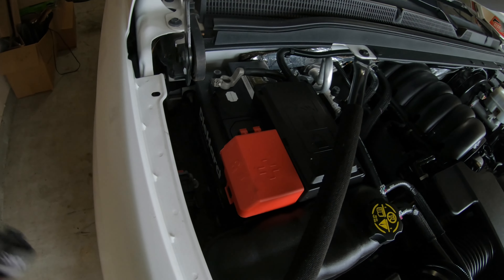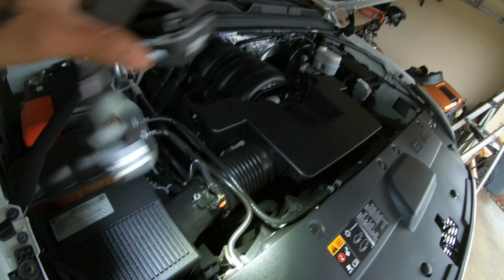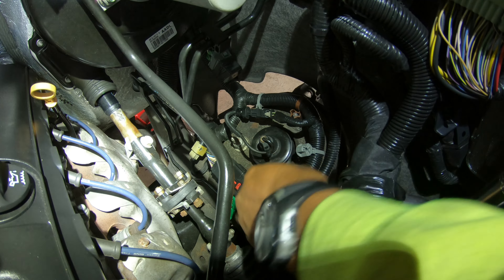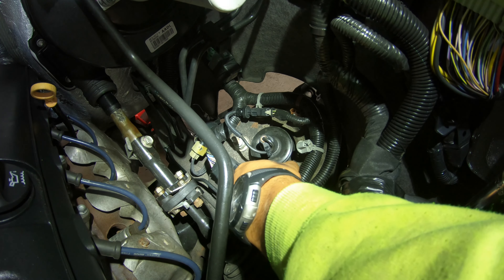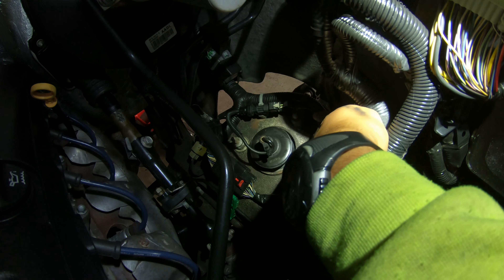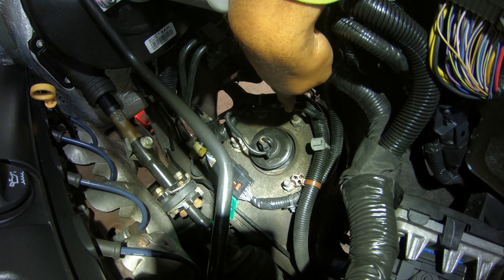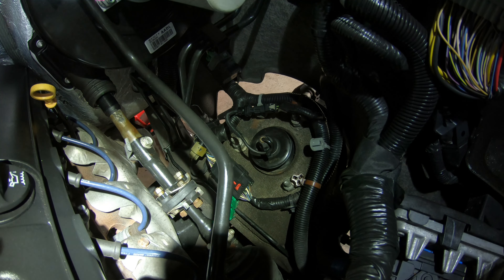Got both of them out. Now we gotta go to the top. Before I go any further, I do have to let y'all know I did disconnect the negative side of the battery terminal because these shocks are electronic — they are controlled by computer, and we will be disconnecting those connectors, so it's a good idea to disconnect your battery. The three bolts up top are covered by little plastic tiles — just pull up on them and they'll come right off. You got one bolt, two bolt, three bolt. These need an 18-millimeter deep socket and they should come right off.